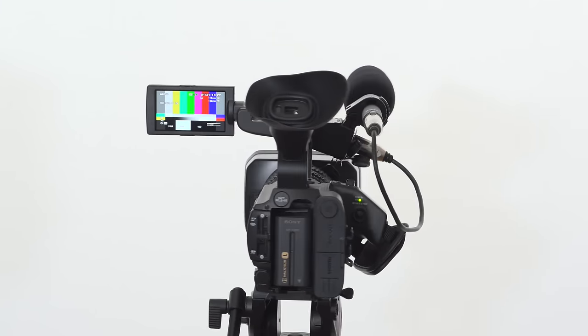It's basically the same camera but updated for modern standards. It's 4K, first and foremost, using Sony's new stacked one-inch CMOS sensor. Rather than having three CCDs with that complicated prism system — where if you knocked your camera you could misalign it — this is technically more resilient to knocks. It's a bigger sensor as well, so we should be able to get a shallower depth of field and more light into the camera.